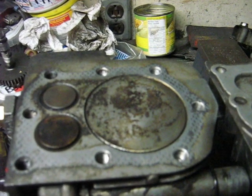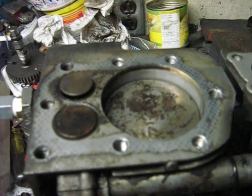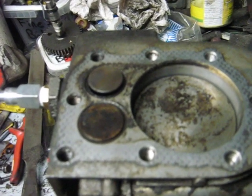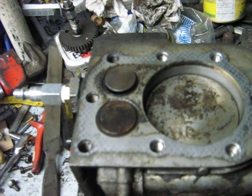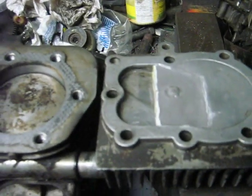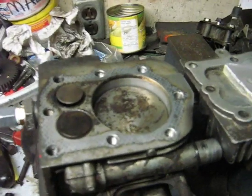So that will, in effect, double the air output. And at the same time, it'll minimize the leakage through the exhaust guide because it'll be pumping twice as much air into that passage, so it doesn't have three-quarters of the time to leak the pressure down like it did before. So anyways, those are the major changes for this time. We'll go out and run it.